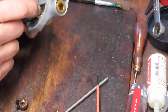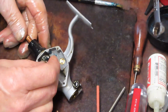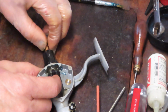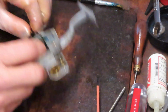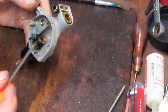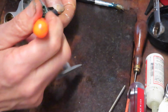Hold that. Hold this. Now we have that little yoke and nut assembly. That's a good place, when I was taking that off, that would have been a good place to take pictures if you were uncomfortable with the way that this went. Looks like this can just get turned in by hand. Not finding any resistance there at all in terms of tightening this up. And then as we tighten this down, we want to make sure that where that hole is for the retaining clip right here, that it's got one of those cross hatches so that we can get that retainer clip in there.